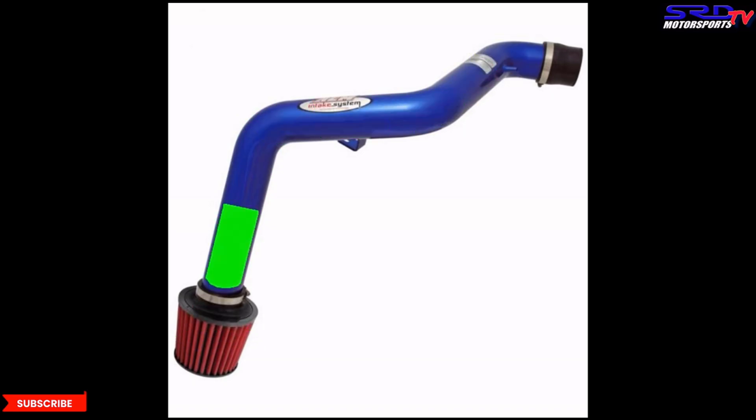Those are columns of air. Of course they're all connected, but let's say they're stacking one another. So if you think about it, just as the last column near the throttle is about to go into the intake manifold, there's another column behind it pushing it. It's going to be good because it's stacking one another and it's going to get inside the engine even more than it's supposed to. And that's one of the steps of increasing volumetric efficiency — one of the steps, remember.